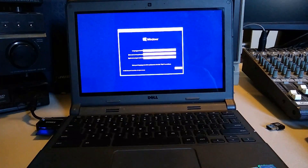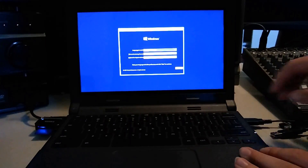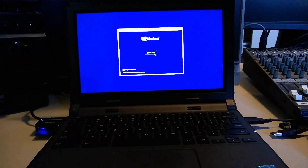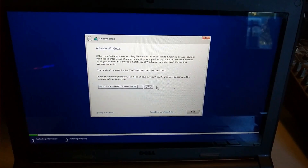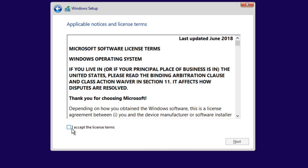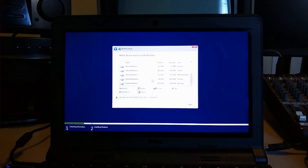Then the Windows installation screen will show and we can install Windows. You will need to plug in a mouse as the touchpad driver needs to be installed. This is pretty straightforward — just select your language, time and currency format, and keyboard method, then click Install Now. It will take a bit, then it will ask you to insert your license key. After inserting your license key, click Next, then tick the box and click Next again. Make sure to click Custom. We now need to select the partition to install Windows on. I just deleted all the partitions and then pressed Next. The rest of the process is very intuitive and if you need help, ask me in the comment section or on my Discord server.